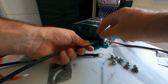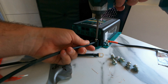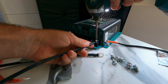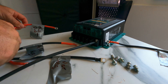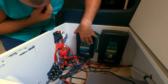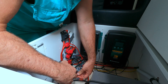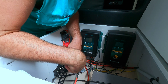The DC charger is the same process as the AC charger, just with a few more inputs. You have a car input which comes from your alternator, a solar input where your solar panels come in, and then a power out which goes to your batteries. It's a pretty easy swap-over since the caravan was already built for these chargers. After attaching all those wires, I just put it in place and reattach the wires I've labeled beforehand — just a simple swap-over.